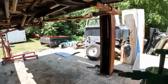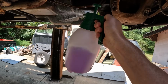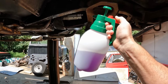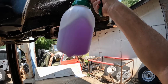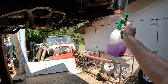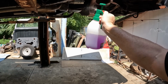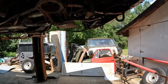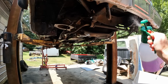So this thing's got an adjustable tip and stuff on it. I usually, even though I'm not gonna paint the engine, we're gonna clean it. Try to get back so it don't spray all over me. Yeah, see how good this thing sprayed? It's gonna spray up in there where we're gonna paint. Let her sit there and soak for a while. Another tip it says also, don't put it on anything hot. You don't want it to dry because it needs to stay wet for it to work.